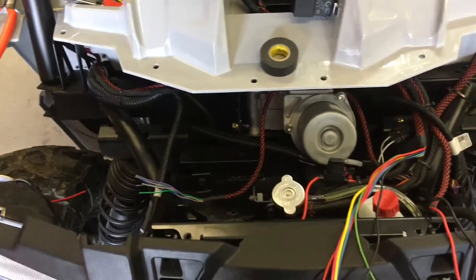Instead of the factory all-red tail light, I'm going to drill into the side right where the 'R' is and put an amber flasher in it so it'll flash. I'm also going to tap into that connection to add reverse lights - they won't be switched reverse lights, just on when the switch kicks them on. These work on any Polaris that takes this style tail light - the right-hand side part number ends in eight, and the left-hand side part number ends in seven.